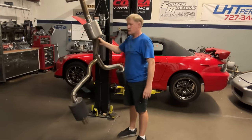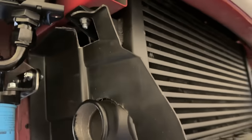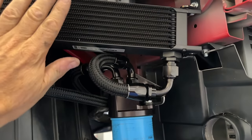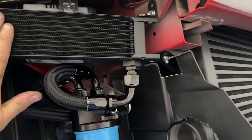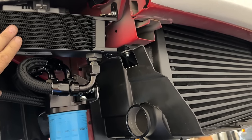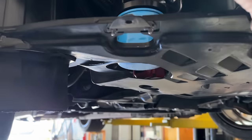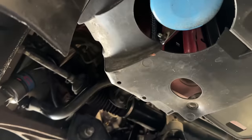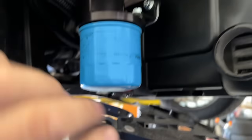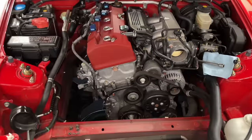One of the amazing things about titanium is it's so light - try doing that with your stainless exhaust. You can see how we did the whole intercooler and oil cooler right here, in an open spot where it can help radiate heat. If you do track work, you'd put scoops behind it to force air across that. The oil filter relocation sits right here on this panel, making oil changes much easier - the oil drains right through that hole into your bucket.